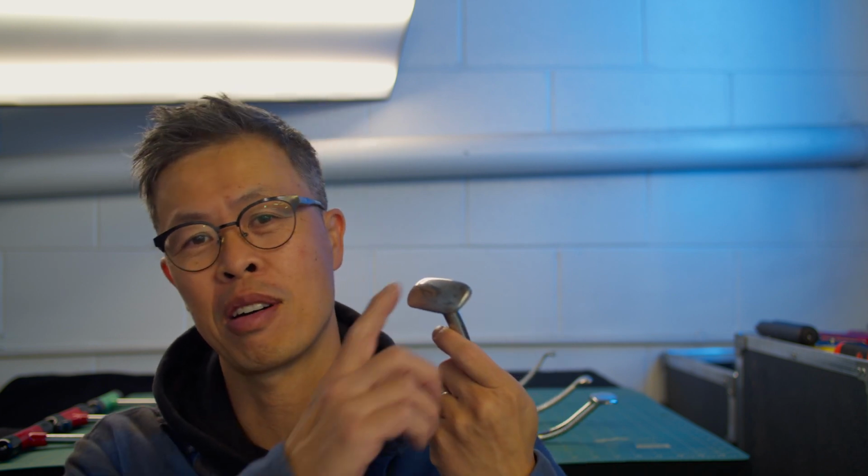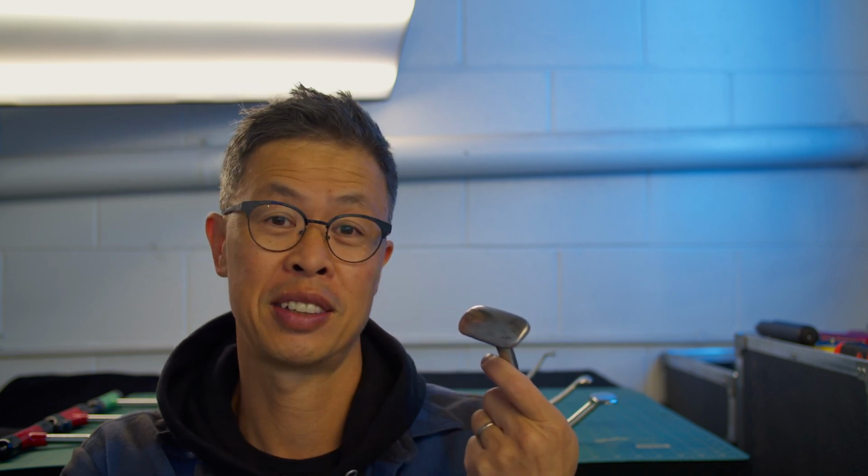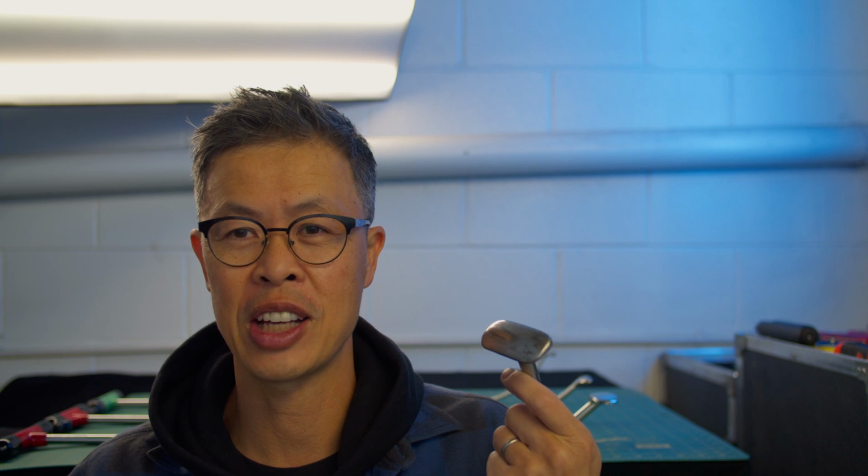And when the fender damage is bad enough, you can lay some hot glue on this guy. Like this next video I'll show you of an HSS Lexus fender I did. It was kinked up pretty bad, and you really need the power to rough out the fender first. Stuff like that, you have to really go at it hard in the beginning, or else you can't get the shape right. So the strategy is to rough it out with hot glue on it, get the general shape out, and then refine it.